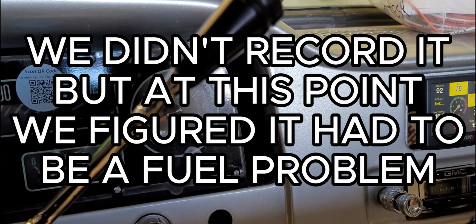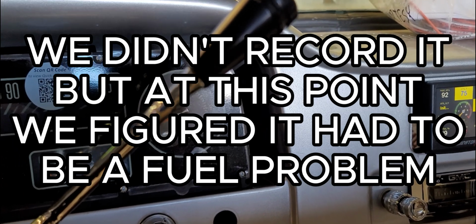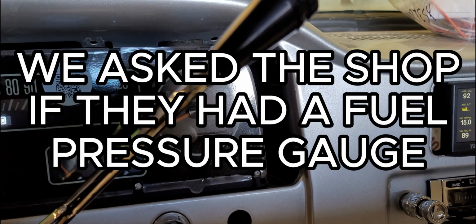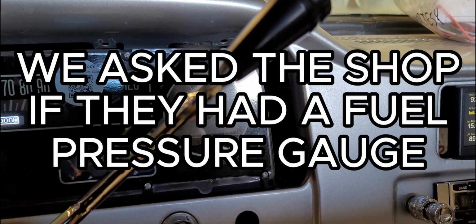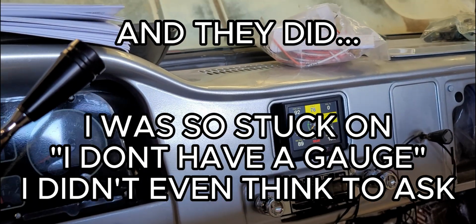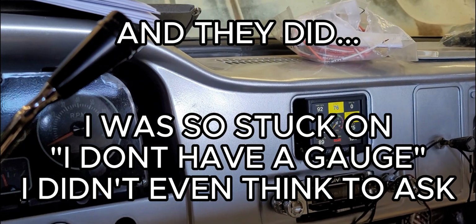Right. But it needs less air. It needs less air for startup. Right. But or more fuel. Well, you can't take that much air. I'm taking all the air away. I think, yeah, it needs more fuel, even for running, because as soon as I move this, it shuts off.